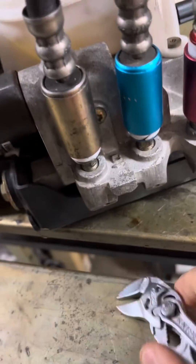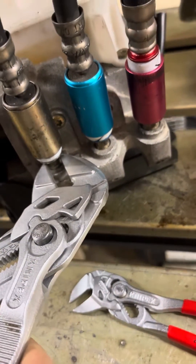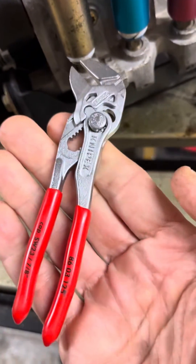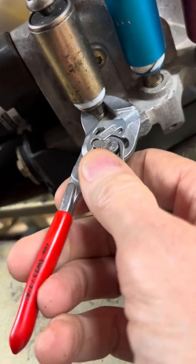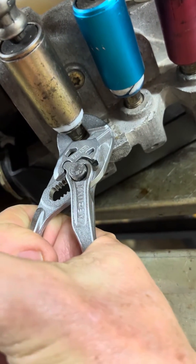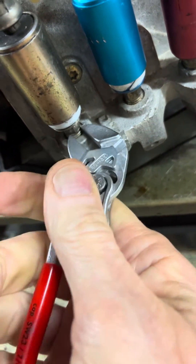A little pair like this — this pair is too big just because the jaws won't fit in there and there's not enough room. This pair is probably a little too small, but they work. To grab the flats and crank on out there. The harder you pry on it, the tighter it pinches it, and it will pop these loose without tearing up the flats.